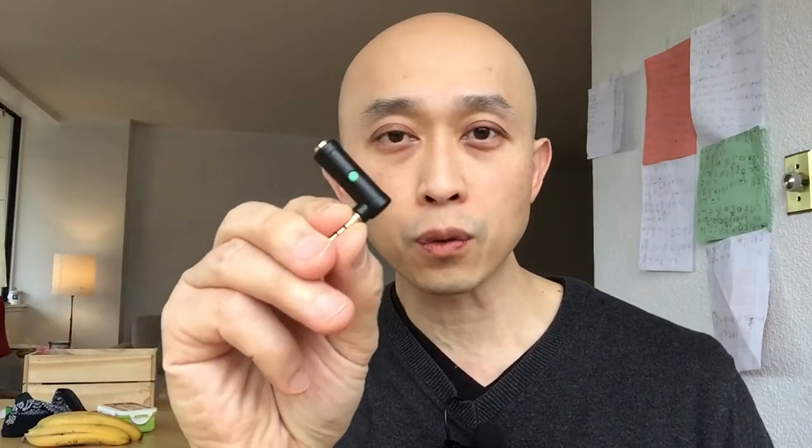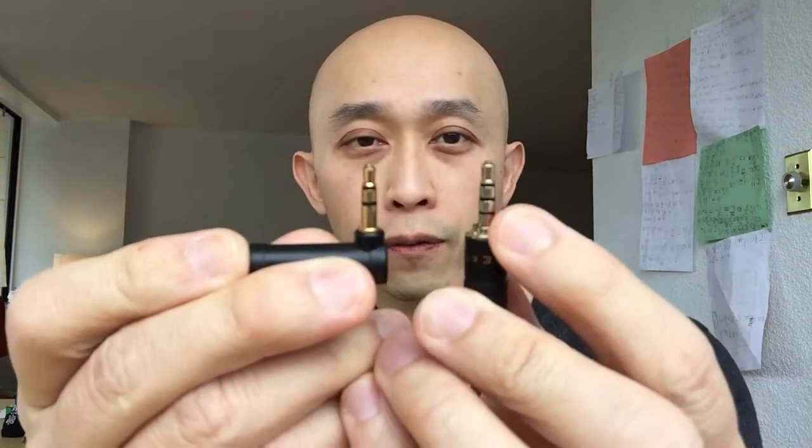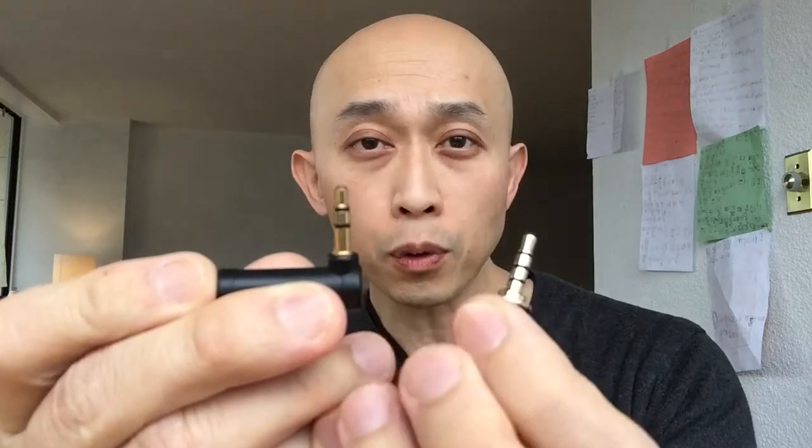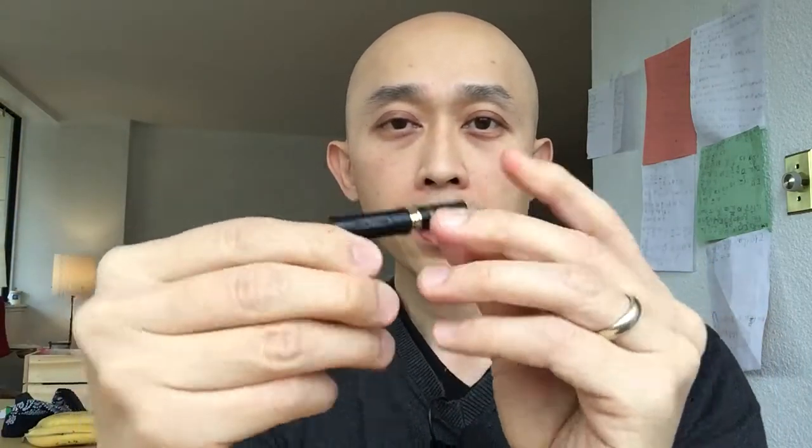So what do you do? Well, all you've got to do is get one of these — it's an ETG 004 four-pole to three-pole adapter, and it's really simple to use. You connect it together. Have a look at this: one of them has four metal rings, that's a four-pole device; this one has three metal rings, which means it's a three-pole device. So if you use a four-pole mic in your three-pole device, nothing will happen. You've got to get this adapter, plug it in, and you're good to go.